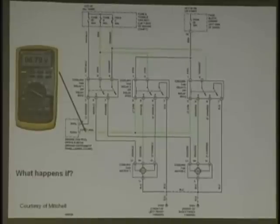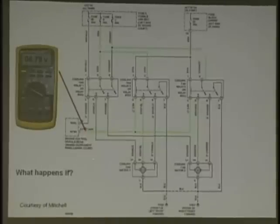And what would you suspect is wrong at this point? Okay, could be a PCM or connection I heard. Okay. Try a contact cleaner. If the ground of the computer was bad, is that going to cause the problem? So you've got to do a voltage drop on that ground and see if the ground to the PCM is bad or good. Usually, if the grounds to the PCM are bad, though, you'd have other systems affected. Other things, right. And that's something else to write down. If you had a bad PCM ground, you would have other computer-controlled components acting strange.